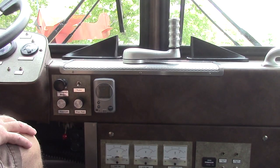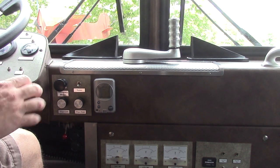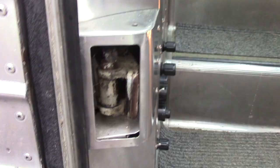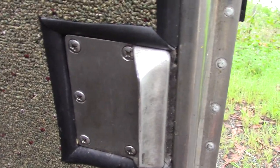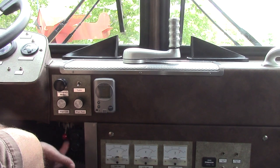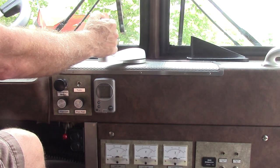One of the cool things about owning a bus is you have the handle to open the door. When you have your air pressure up, there's a clamshell that grabs the door and pulls it in tight when you're going down the road — it keeps down air noise and is also a safety feature. This is the clamshell lever right here. When you activate it, it grabs this part of the door and pulls it in tight so you can't open the door. That's controlled by this little red switch right here. When you open the door, you get this really cool air release noise.